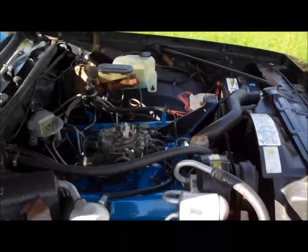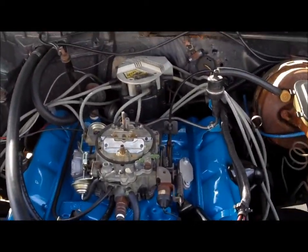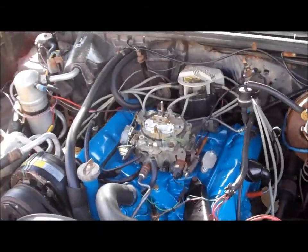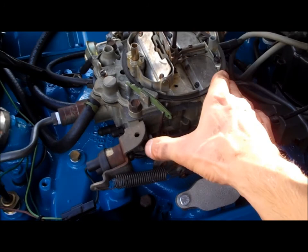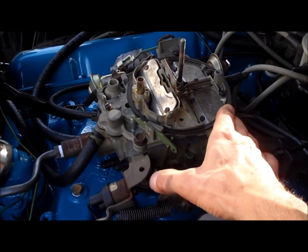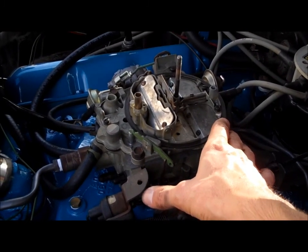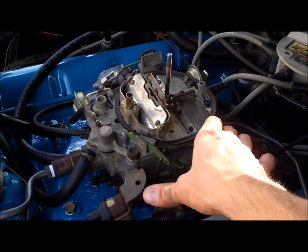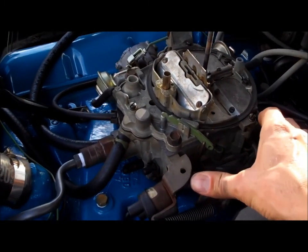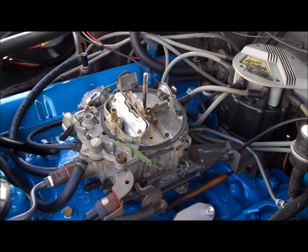So far no leaks, that's a good thing. I know I've got to fill up the transmission fluid a little bit. That lifter tick should go away — I think it was the lifters collapsing from all the water and the cranking. It already sounds like it's getting quieter. Wow, this thing runs pretty good. I know the motor's cold, the carb needs a little idle adjustment as far as the idle mixture screws, which are located at the base of the carburetor. Yeah, the lifters already quieted down.